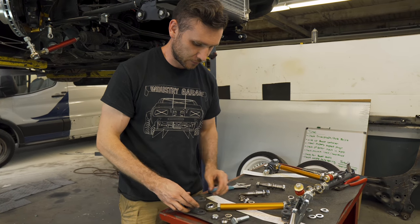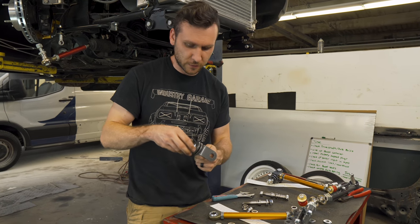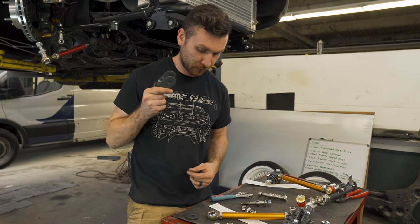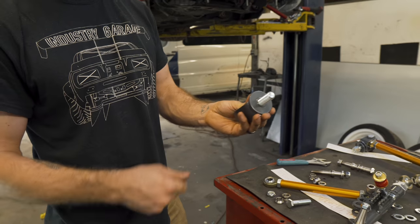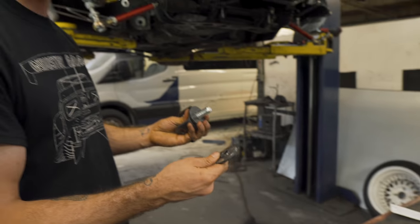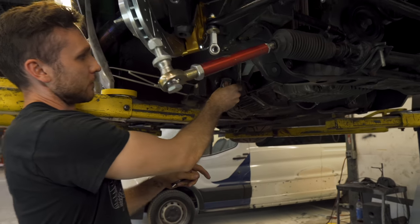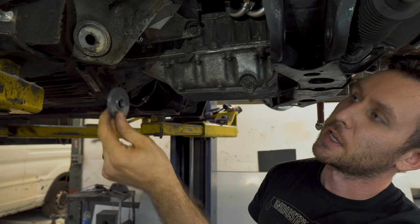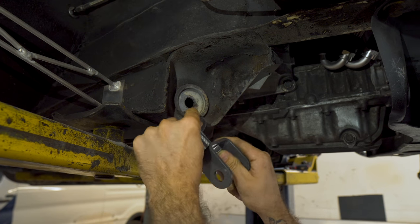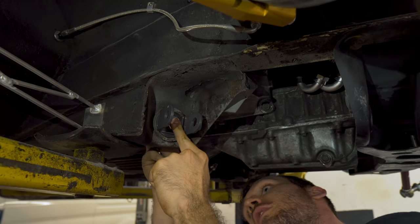I'm going to take these mounts off of the TC rods and then mount these pieces first, because it's a lot easier to get it all set up if this is already bolted to the car. These actually have a little lip on them — there's a lip on both sides and they powder coat all this stuff so it's not going to be rusting on you. Everything else on your Z car is going to be rusted, but not your arms. So these just press right into these little pockets. The little lip on there goes in facing in. Then the other one faces back towards it. Crash washer. Bolt.